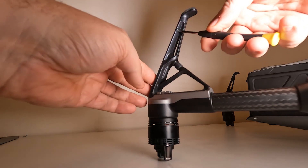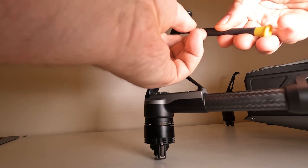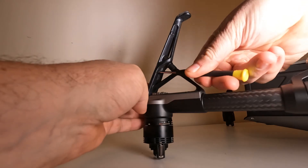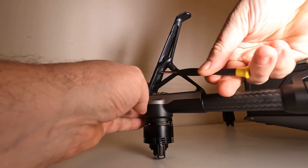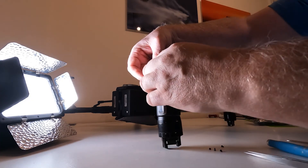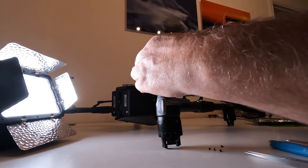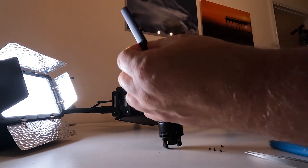On the outer surface of the leg there's a cover held in place by four screws. All you need to do is get a Phillips head screwdriver, undo those four screws, and then you can usually prise off the cover with a fingernail. It's held in at the top and bottom, so if you need to, slide something thin in the middle and just pop it out - it will come out without any damage.